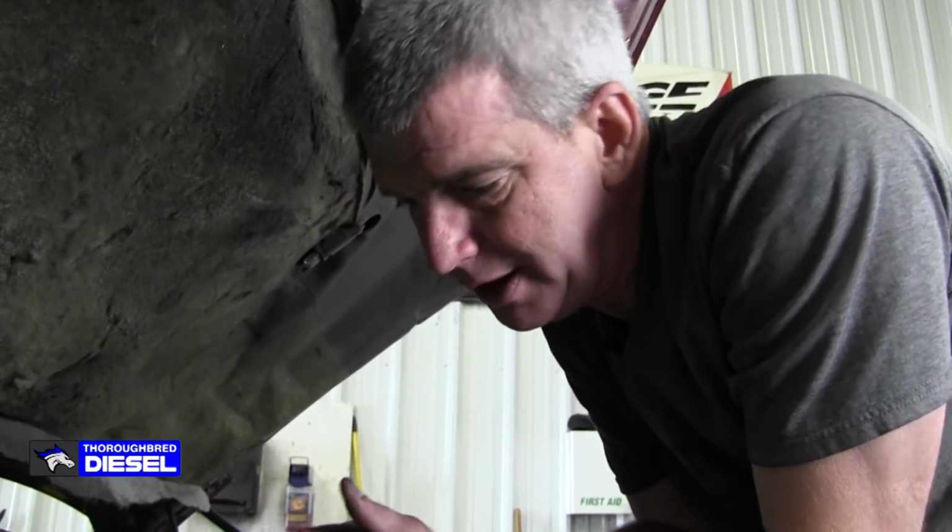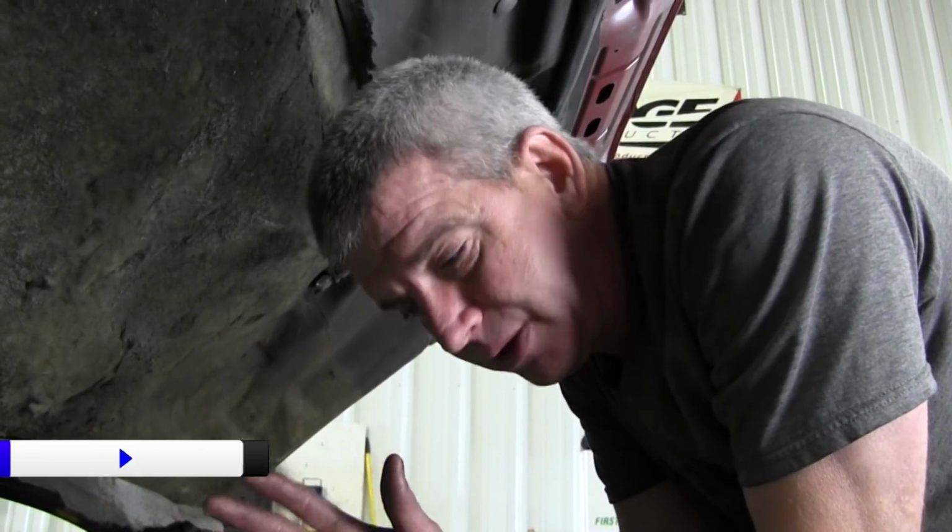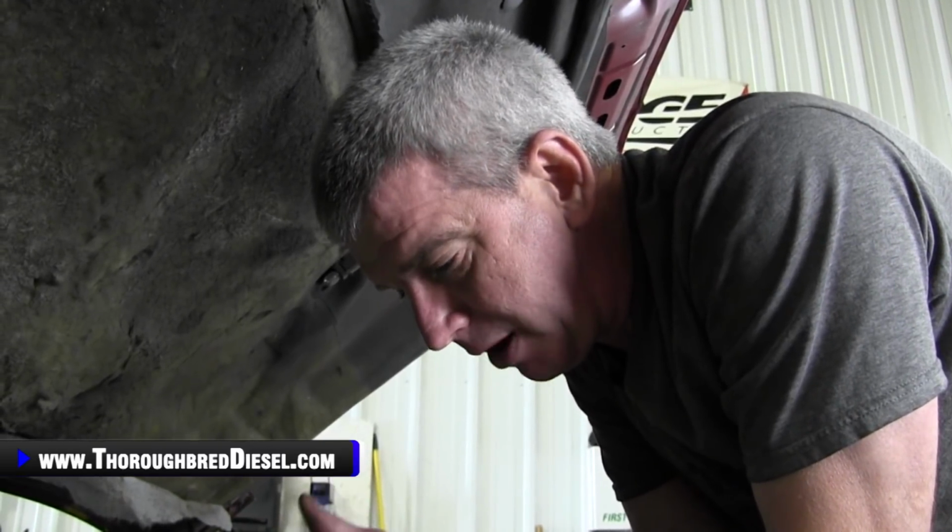Check our video out for that. Pull the valve cover back off, and that little bit of heat might be just exactly what you needed to get the glow plugs out. They may spin right on out for you, no problem.